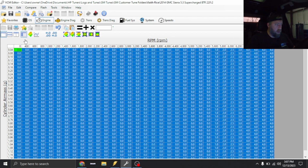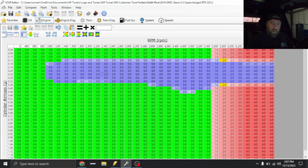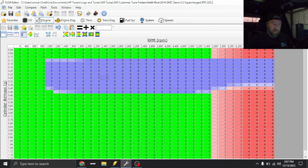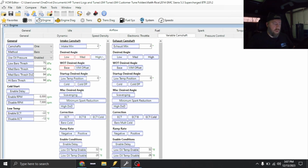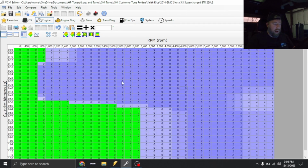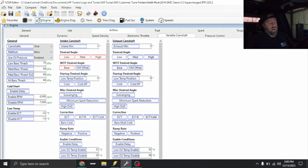So then what we're gonna do is copy this. Now, if this vehicle didn't have a 4 degree limiter, technically this camshaft could get away with a more aggressive limiter, and you could have some cam timing retard at cruising areas to help with pumping loss. But with 4 degrees of lockout, it's just not worth it. So anyway, that's got our variable cam timing set up, squared away.